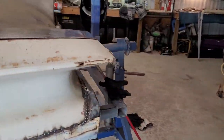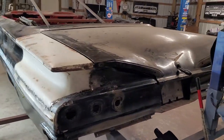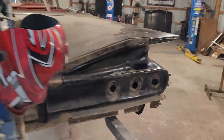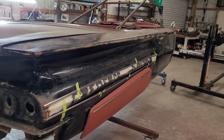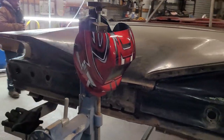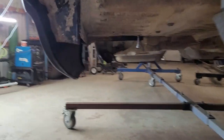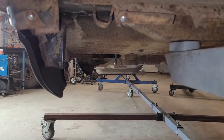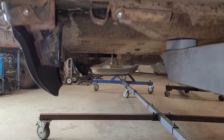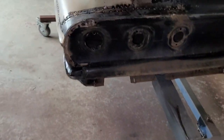You did a great job. We were at 50% earlier — I think we're at 95% now. That was the last of the big pieces. We still got to finish welding and do a little bit more work, but after that we flip it on the side and do the drop-downs and the wheel well stuff, meet the wheel lips up with the quarter panels. But after doing this, that's nothing.